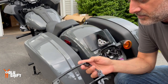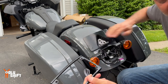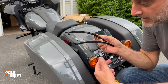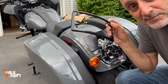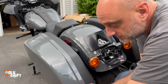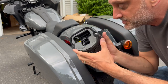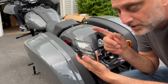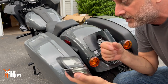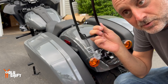I didn't prepare for this — I thought it was just a license plate that's curved and lays down. I did not know there was an LED option. So I'm not going to deal with this right now. I'm going to call Custom Dynamics tomorrow because I didn't find anywhere over here where I'm supposed to get my feed for the running light. I opened it up, maybe I can tap it there, but it's not exposed. I imagine that in the Custom Dynamics tail light they're setting up for the ST, there's a solution for this. For now I'm just going to install it as-is, ignoring the LED illumination of the license plate, and I'll do a follow-up video once I figure it out.